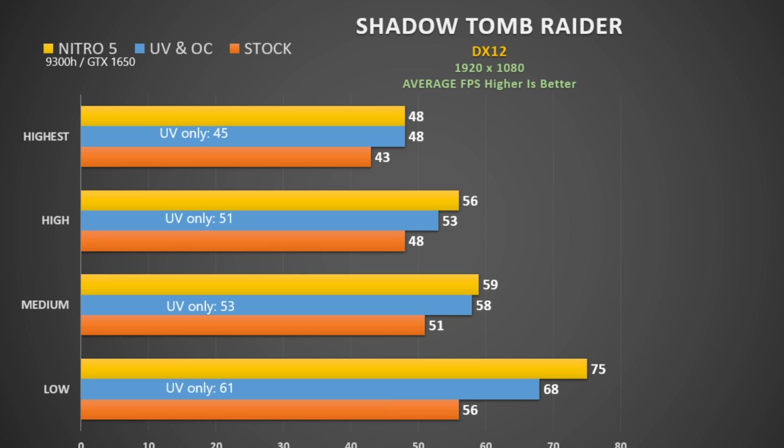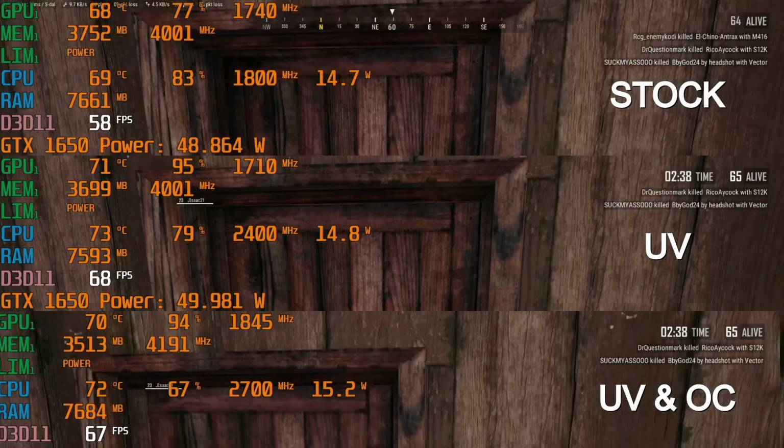At all quality settings, it is beneficial to have, especially as you lower those settings and the game becomes more CPU bound. Single channel RAM will just bottleneck the system, and as games start to require higher PC requirements, you are unlikely to benefit by dropping settings. Thus, the useful lifespan of the L340 and the IdeaPad Gaming 3 will be lower. Undervolting is a must, and if you can squeeze a bit more out of the system with an overclock, then even better. We actually get quite close to the performance of a dual channel system.